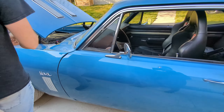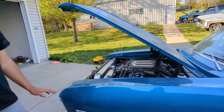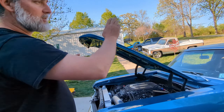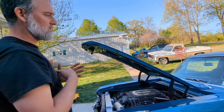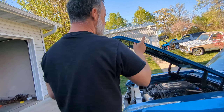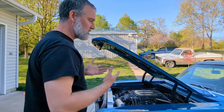It's running really good — we have a video clip of us test driving it. We have one issue to work out: it won't start when you turn the key the first two to three times. The problem is the battery is in the trunk, so the Gen 5 computer is a little sensitive to voltage drop. If it goes below nine volts, it's not going to work. Because the battery is way back there, and the power probably comes through too small a gauge wire, it's kind of random when it actually fires.